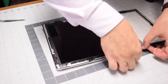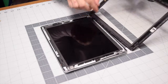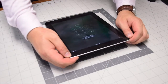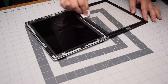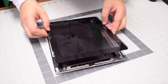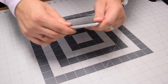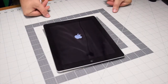Peel off the tape backing. Fold the screen over but don't fix it completely yet — power on the iPad to make sure everything is connected and functioning. Then power down again, reclean the inside of the digitizer, and clamp it shut for good. Make sure everything is aligned correctly so all seams line up and you get a nice seal with no visible cracks. Wipe the fingerprints from the screen and you're all done.